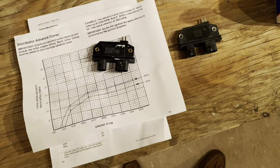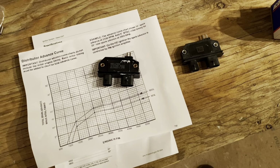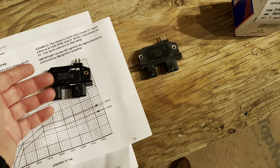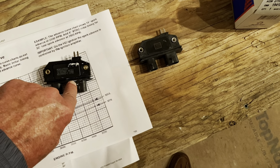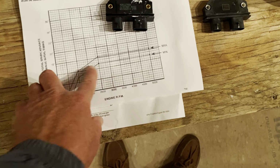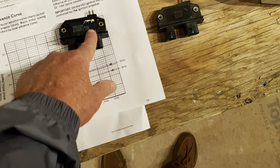I've already discussed this at length in the other video. Again, the link is in the description of this video on how that works. But on car and truck modules, you connect the 12 volts. So if I had this timing tool, you'd connect 12 volts to the B terminal, which is the third one from the right. And that tells the module, don't use the internal timing curve. Don't use this 0 to 13 to so-and-so. Use the signal from the computer to run the car.